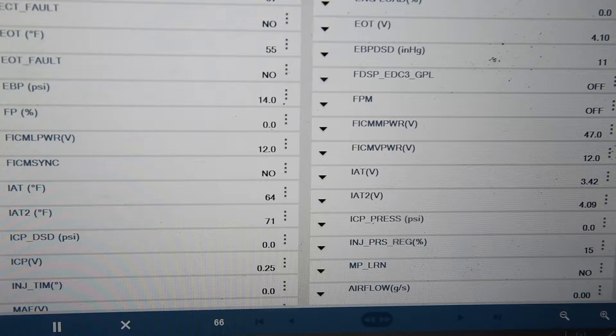47 and a half is normally acceptable, 47 isn't. What I'm going to do is cycle the key and show you what happens. As you can see, as you put a load on it, the voltage drops right down to around 40. This will drop down even more if you crank the engine. Just because it holds voltage when you cycle the key doesn't necessarily mean it's good. You should always check it by cranking the engine because that's when the biggest load is on the electrical system — that's sometimes when you'll see the drop in voltage.